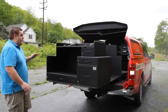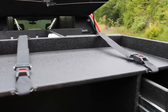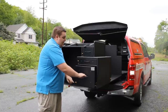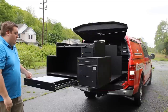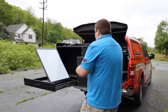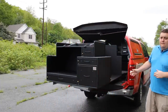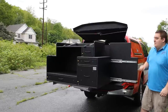With the cabinet slid out, you can see we've designed this one specifically for this customer and the equipment they were carrying. Up top, we have a spot to mount a piece of equipment with straps to secure it. There's a small set of drawers for storing small equipment, a standard file drawer with rails, and our custom magnetic dry erase board. This is a side-flip design so the customer can stand and operate the radios without pulling the cabinet out. On the other side, we have a large storage area for hand tools, extinguishers, and a slide-out mounting board for their pack.